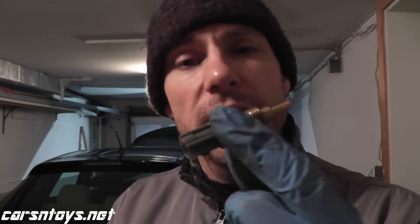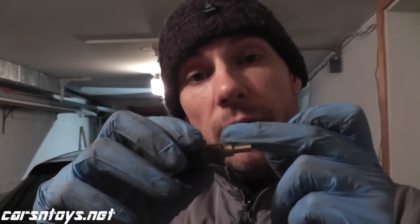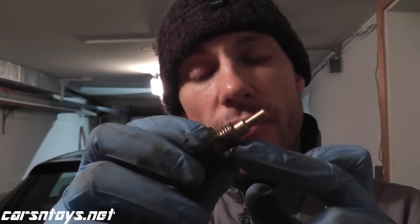That's all it really takes to test one of these sensors. Just grab yourself a hairdryer, apply some heat, and see what the reading is on your multimeter. Chances are if you're getting a trouble code, this needs to be replaced. If you do a test and the sensor is perfectly fine but you still have a trouble code, check the wiring — the harness connector may have a break somewhere, maybe there was some water in there, it wasn't on all the way. When you do reinstall the sensor, apply some silicone or RTV sealant to the threads because you may have some oil leakage if you don't. Thanks for watching.